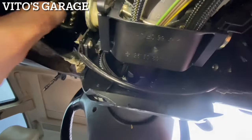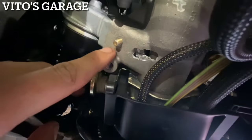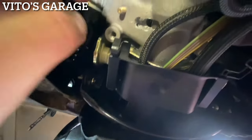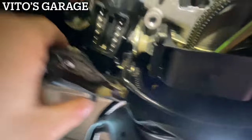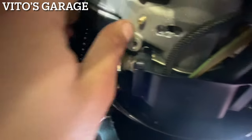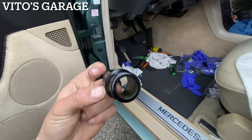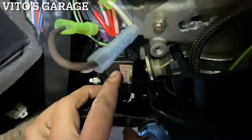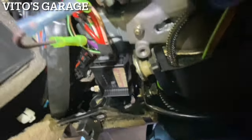With the key turned to ON, the slot opens up for the bolt to go through. Check how much thread is sticking out — it should be smooth on top with nothing protruding. Go ahead and install the nut, then connect the cable. Not too bad of a job actually. Here's the barrel — I just touched it up with black paint. It's actually in decent condition. Everything is back together, nut is on, connector is in. Still need to fix that purple wire — I don't like the way they made that repair.